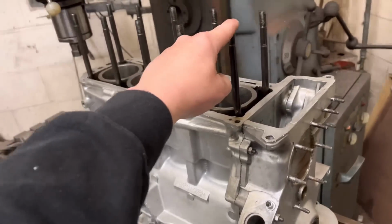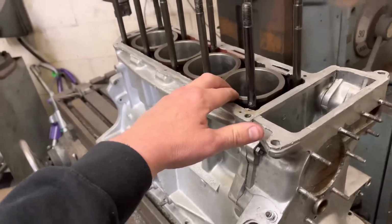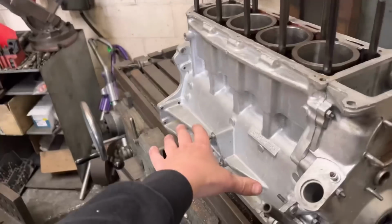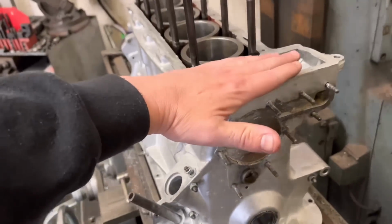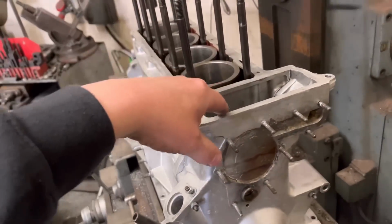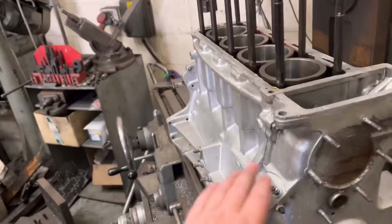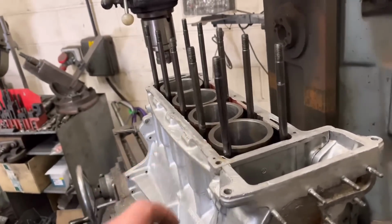Getting these studs out is an absolute nightmare, so we're not even going to attempt to do that. Clock the liner rather than try remachining the base, because that could end up an absolute nightmare. I think what Bob wants to do at this stage is clock that liner. Might have to lift the block up at the base to get the liner flat, which is then obviously going to put the top of this block out slightly, and then we're going to face around the top of the block with a long series end mill. So we'll get this on parallels once that job is finished, because I'm using the parallels at the minute, and first of all we'll put it on the parallels as it is, and we'll clock these liners and see how far out they actually are in comparison to the top of the block.